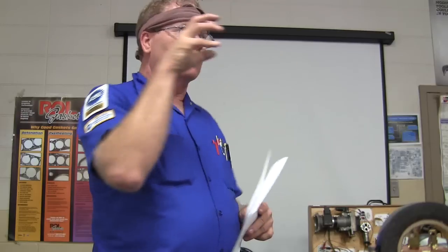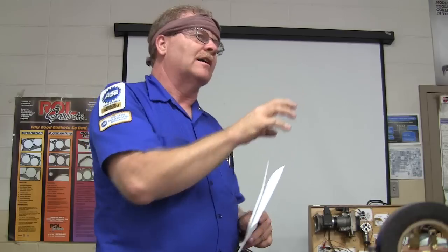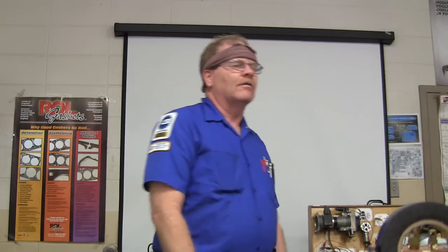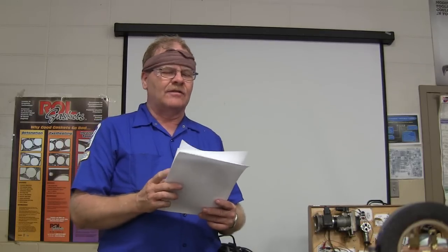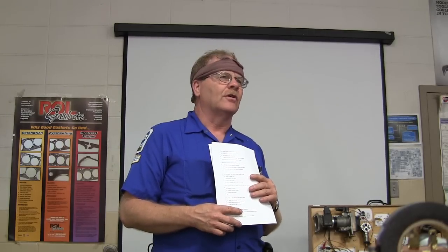What do the driving devices do? They transfer power from one component to another — depending on which planetary gear set components are held, that's what gives you a different gear ratio. Which is a symptom of a faulty transmission fluid pump? If you've got a bad pump, you've got to have fluid pressure before the transmission will move — so it'll either slip or won't move at all. I'd like for everybody here to put a transmission pressure gauge on their car and drive it for a day so you can see what the pressure normally looks like.